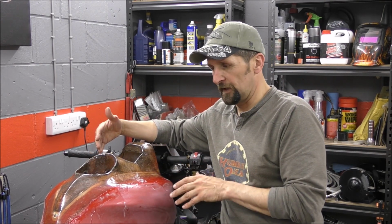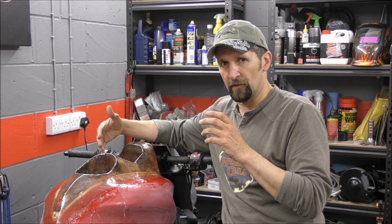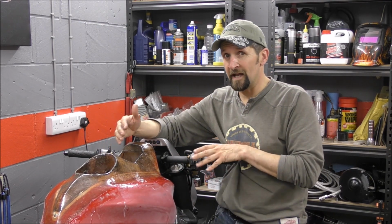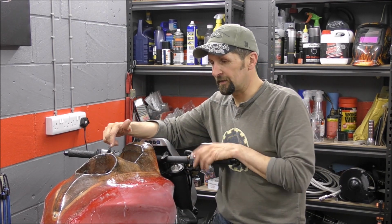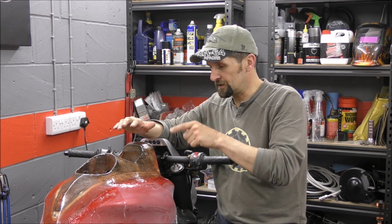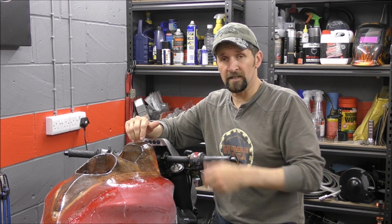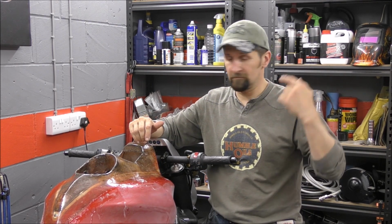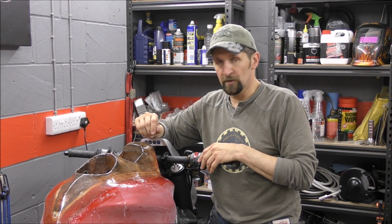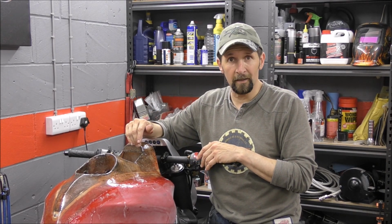I didn't want to do it with filler because filler is really heavy and not particularly very secure. It's quite fragile, and the thicker it is, the more prone it is to crack, so virtually not going to need any now. The rope trick thing was purely a case of wanting something light that doesn't weigh anything, that I can stick down, is the right shape, and I can resin it. Really and honestly, there's no reason for it other than that. It's just what I had there in the box, a bit of rope, that'll do it. It could have just been a bit of tubing or something, anything, but there it is, it's done, it's in there, and you'll never see it again.